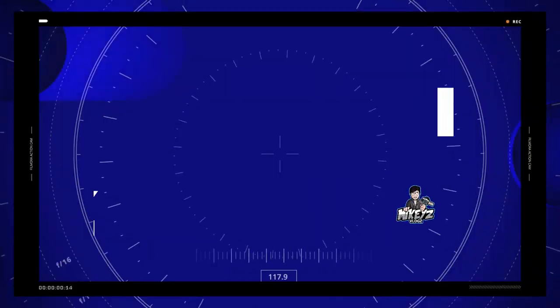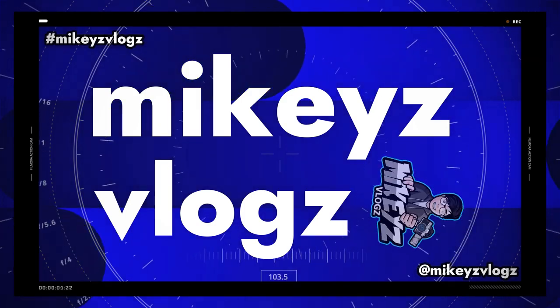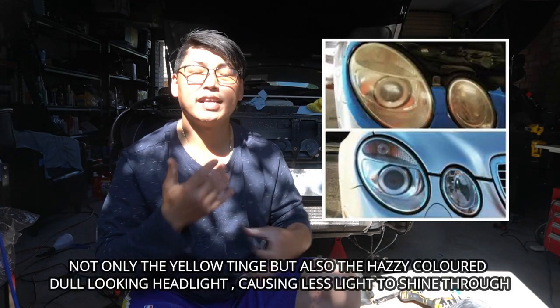In this video, I'm going to show you guys how to restore your headlight. Now this is for any type of car because this common issue happens on any type of car. And the reason it happens is after a long period of time, the plastic lens on your headlight tends to form a lot of dust and a lot of contaminants tend to cake onto the top layer of your plastic headlight lens. And eventually the UV rays from the sun burns on that layer of contaminants and dust and dirt, therefore creating that yellow tinge.